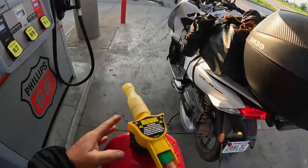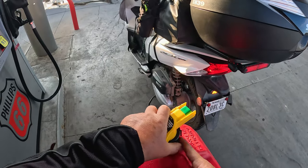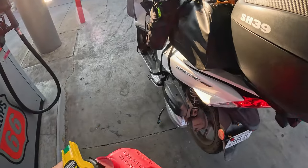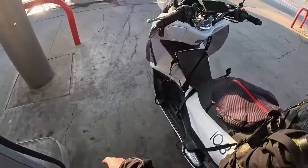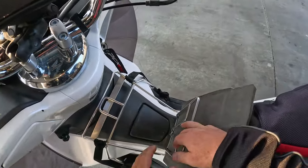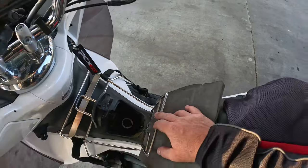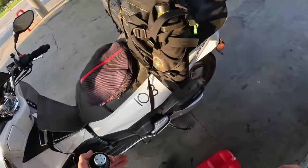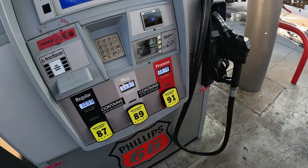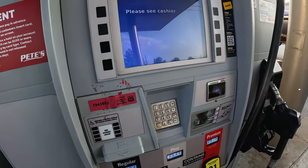And again, don't misconstrue that, the original pulley, the torque unit, the whole system, that was factory in this, it was never changed out, so I think it was defective from day one, because this bike has always had a propensity for shuddering the belt and having problems taking off sometimes. So I think that might have been a defect from the factory, and I just limped along with it, never really knew any difference for a little while, until I had gotten my 2016 PCX, the gray one, that is now Adrian's. That bike was always butter smooth, and I was like, wait a minute, why is this bike so smooth and mine vibrates the dash to death when I take off? So anyway, I don't think the Dr. Pulley was all of the problem. We definitely saw that it ate its center bushing on the variator.